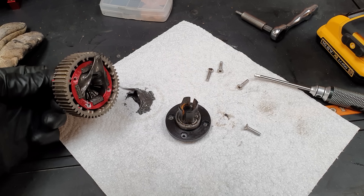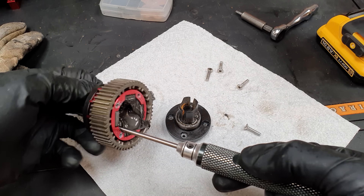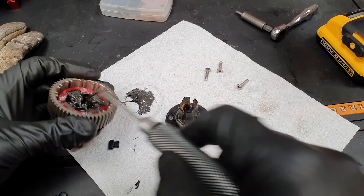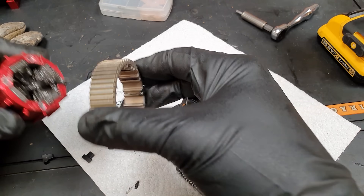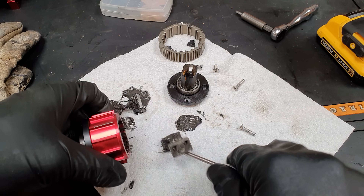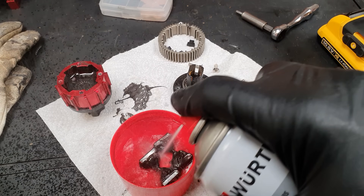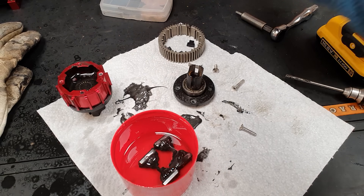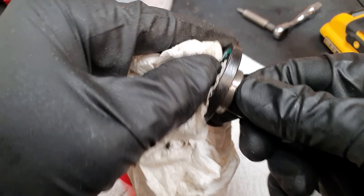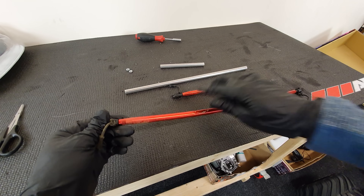It's been about an hour and only a little bit has come out. We're going to have to clean all of this stuff off properly — if we leave it and top it up with an earplug it's going to dilute it and water it down. I'm using brake cleaner, hoping that'll dissolve it all. The more of this diff fluid I can get off, the better the diff is going to lock up with the earplug.